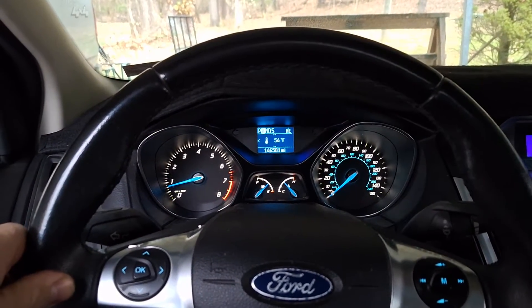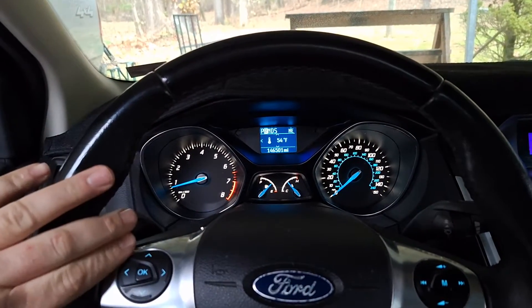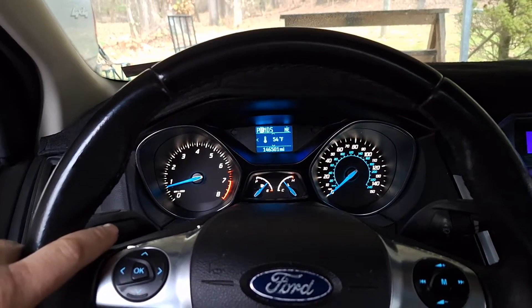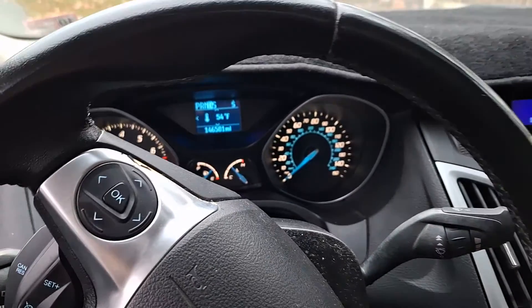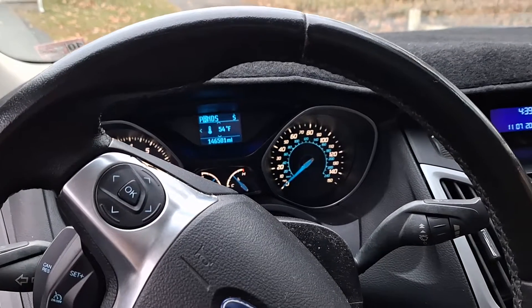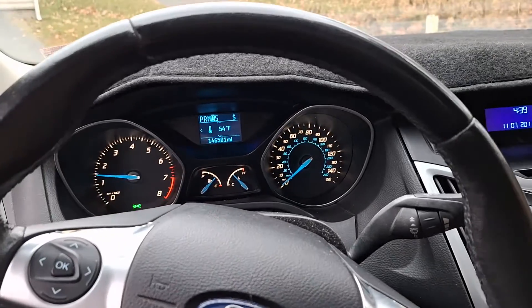The purpose of today's video is I'm going to drive it around and see if it will learn on its own — if you drive it long enough, if it'll learn. I'm going to start driving it here. I'm on somewhat level ground right now and I'm just going to drive, giving it some throttle, reverse, some throttle, let it learn the touchpoint — back and forth a bunch of times until it starts feeling like it's improving.